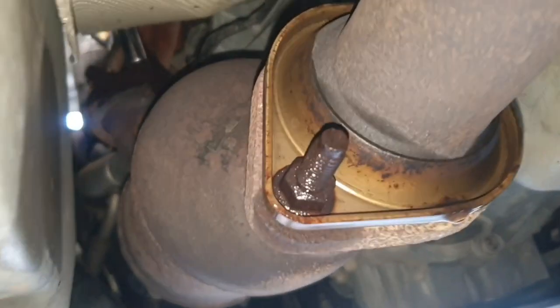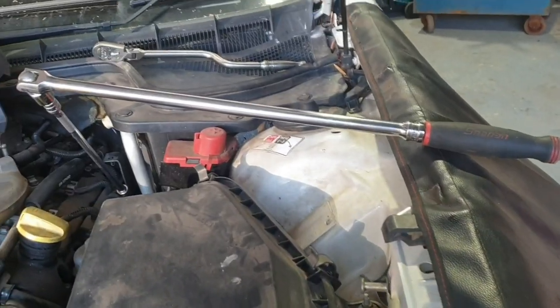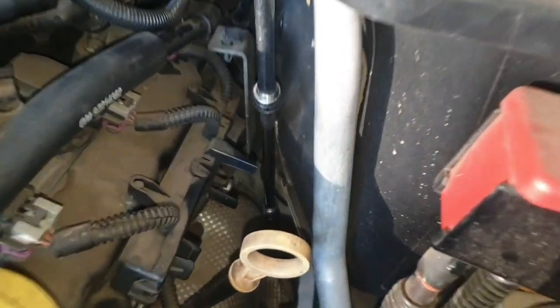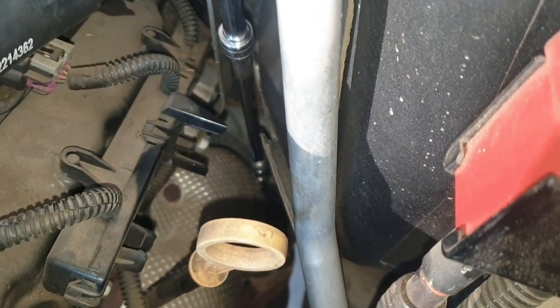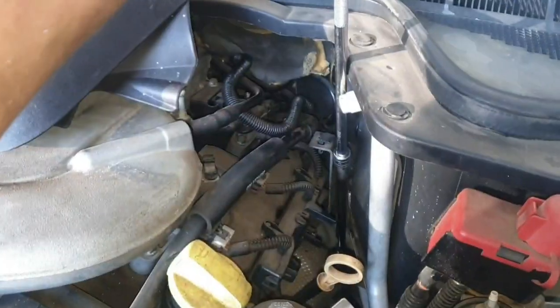With some ninja hands I was able to get the socket on the back nut to undo that catalytic converter, so I should be able to get my extension down in there and crack that off. I've also sprayed these ends with some CRC to get them out of the way. My setup was: breaker bar, two 300mm extensions onto a wobble drive, onto a uni socket, onto the 15mm — it cracked it. Use the ratchet to continue. The setup was single hex socket, uni, wobble drive, which you can probably get away with just the wobble drive extension bar, another extension, and a 3/8 drive ratchet.